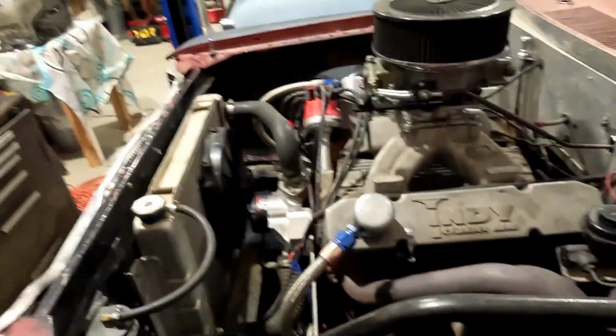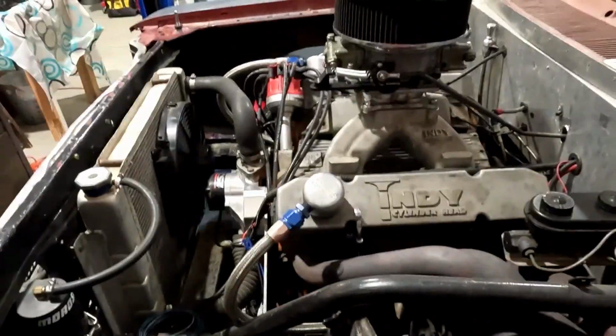Fingers crossed. Four-leaf clovers, good luck charms of sorts. I replaced the pump seal, the pump O-ring, the input shaft seal, and put new washers on all the bolts. Some combination there sorted the problem, it does look like. I'm happy about that. We can get ready to go again for the next one.